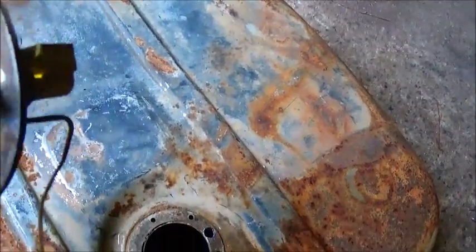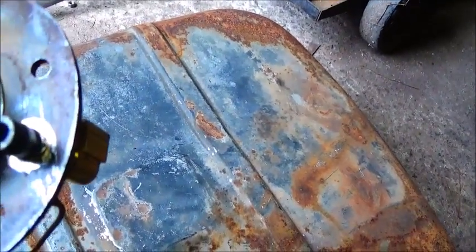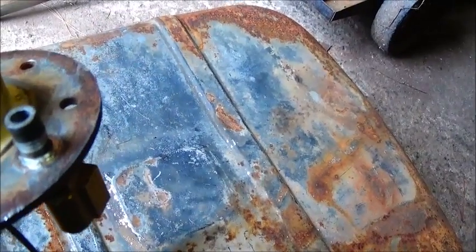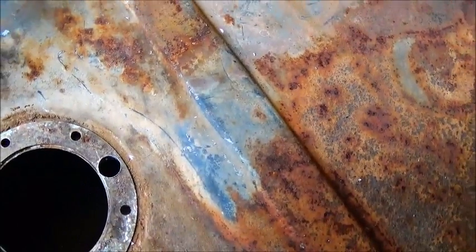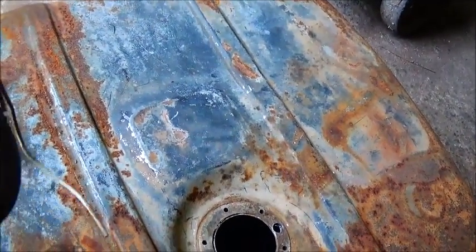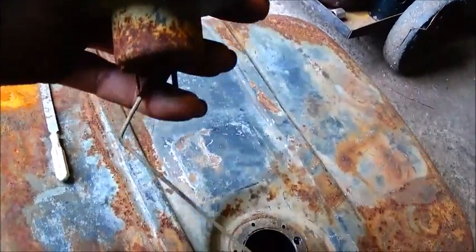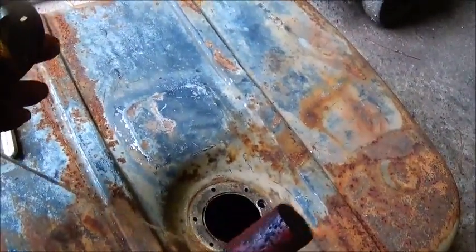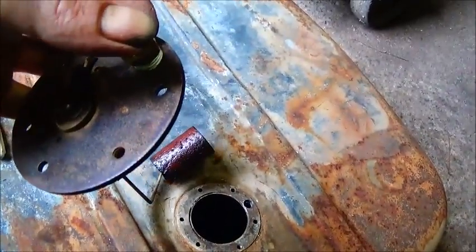And that gives us a good mounting surface around that. It's not as bad as it was with the big hole, and so it'll seal up fine. And we just got our hole here. So I think it's going to be just fine. That'll keep the fuel coming out lower. We won't have to worry about the leaking around it. So, alright, I just got to make a gasket and put it together, and we'll have her finished up.